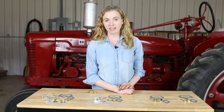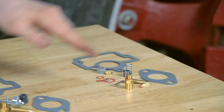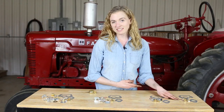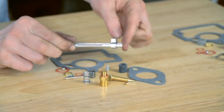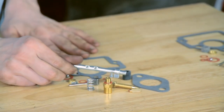When you are ready to rebuild your own carburetor, you're going to need a repair kit. We offer four different levels of repair kits, so let me go over them. The first is what we call our economy kit — just gaskets, needle, and seat. If your carburetor basically just needs a good cleaning, this is the kit you want. The next jump up is the basic kit, which has all the same pieces plus a new throttle shaft, which does wear out, so this is a good kit.